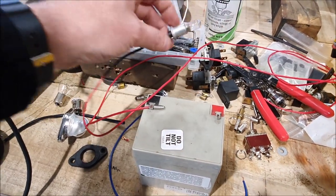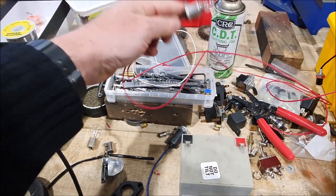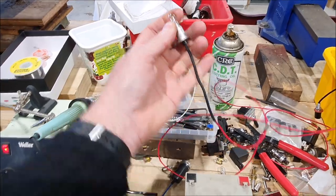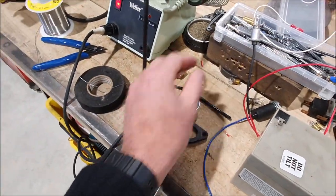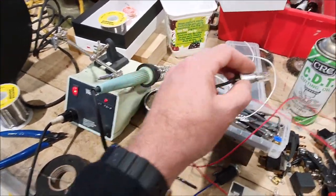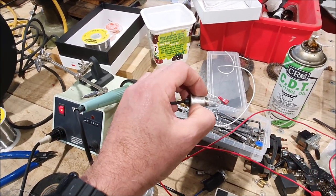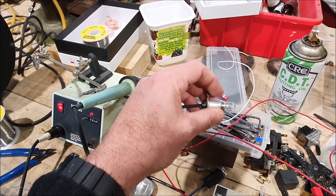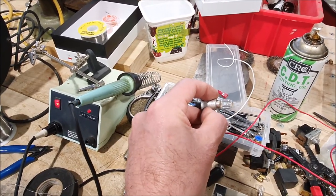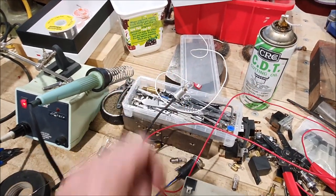These are a much softer, dimmer light, which is all you need for the number plate lamp. To be honest I'm not really intending to be driving that car after dark anyway - it just needs to be able to get its warrant of fitness. I've extended this wire and drilled holes in the body so I can actually mount this thing in there. Because it's an aluminium body I don't need a separate earth - the whole body is earthed. I'm going to use a rubber grommet or a piece of rubber hose pushed over the end to clamp it in the hole.